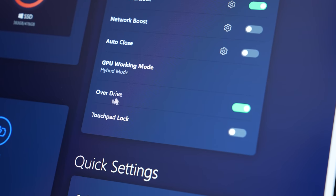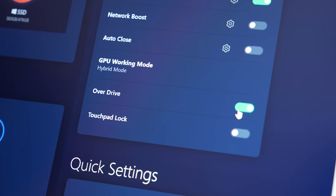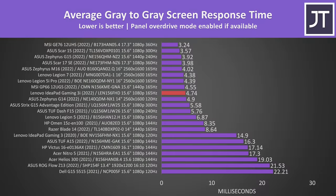The screen that came in mine is also pretty great, which is good considering that's what you're going to be staring at while playing games. The IdeaPad gives us the option to enable panel overdrive mode through the Lenovo Vantage software, and it's on by default. This lowers the screen's response time to 4.74ms, which is quite a great result and close to much higher end laptops. Other gaming laptops in the same category typically have much slower screens. This only applies to the 165Hz panel I've got here — I'd expect lower results with the cheaper 120Hz option.